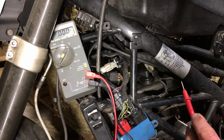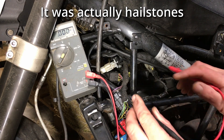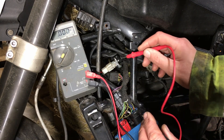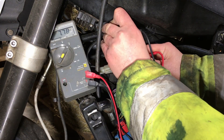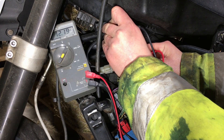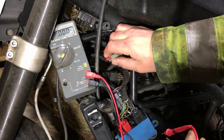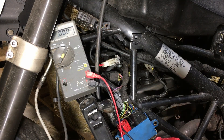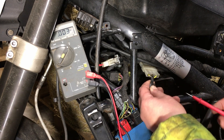It's just started raining quite heavily so it might get a bit noisy. I'm going to check that we've actually got power going from here to the battery — we should have 12 volts. Measuring to ground: 12.3, so we know that's connected to the battery. I think it's either this regulator or the magneto/alternator down in the bottom there. Let's have a look.